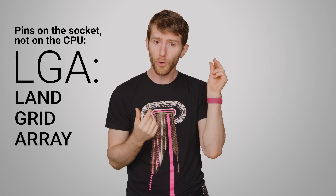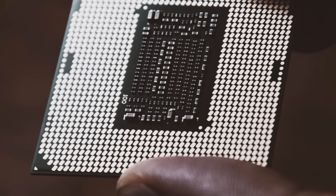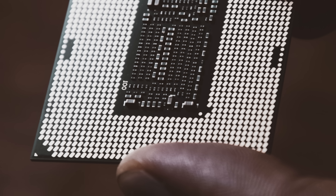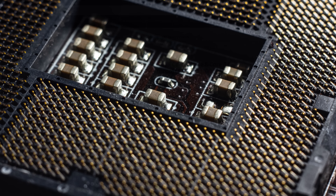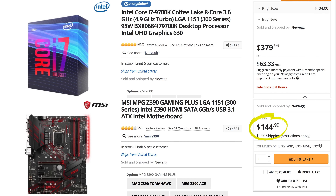Intel's approach of having pins on the motherboard instead of the chip, called a land grid array or LGA, typically makes it easier to fit more contacts into a smaller space on the CPU. Modern CPUs need a lot of contacts for high-speed features and to promote stable power delivery by spreading out the current. The other thought is that because tiny pins are very fragile, it would be better to place those on the motherboard rather than the CPU, because it's not uncommon to see a $400 CPU installed on a $150 motherboard. So if one of those things was going to break, you'd rather it be the cheaper one — then you can reuse that CPU on a new motherboard.